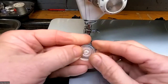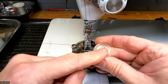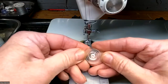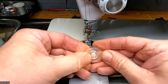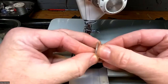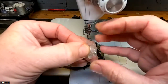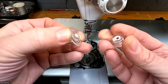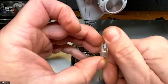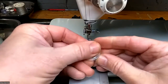I know you said you have four bobbins and they all do the same thing. Make sure you check the underside of all these bobbins and make sure that there aren't any burrs or anything on there — and that includes the center point. Remember, these bobbins actually unscrew in the center. You can unscrew this and remove the old thread easily that way. But when you screw them back, make sure that everything is good.